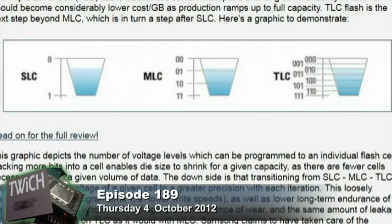What's interesting is this is the first time we've seen triple-level cell flash used or mass marketed in an SSD. Single-level cell is basically one bit per cell. Multi-level cell adds more bits, and triple-level cell takes that further — it's an interesting idea that you can use fewer cells to store more data. The tradeoff is you sacrifice some performance and some long-term reliability. Don't panic — Samsung does very good firmware and has very good products. But write speeds are where things start to suffer. Available in 60GB, 120GB, 250GB, and 500GB.